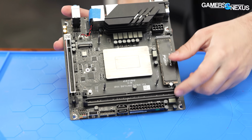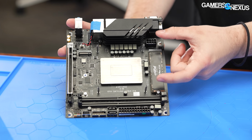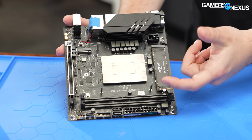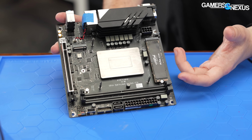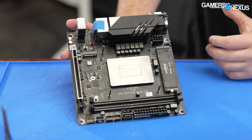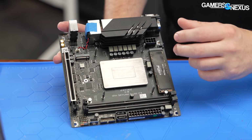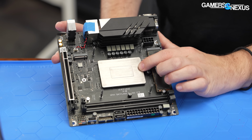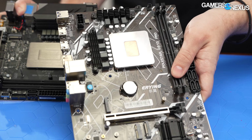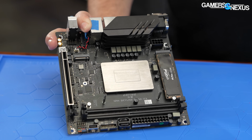Because if you think about it, if they're trying to maintain some kind of compatibility for coolers as they would mount on a DIY solution, then they have to adapt the laptop component to be able to meet standard market coolers, one, without cracking the silicon underneath, and two, while actually reaching them. And so this is to maintain Z height and also get some kind of IHS for protection and for spreading that heat, or integrated heat spreader if you don't know. It's a 2-part construction. On their other one here, they put a copper slug centrally, and on the ITX one, it is all just a sort of brushed aluminum.